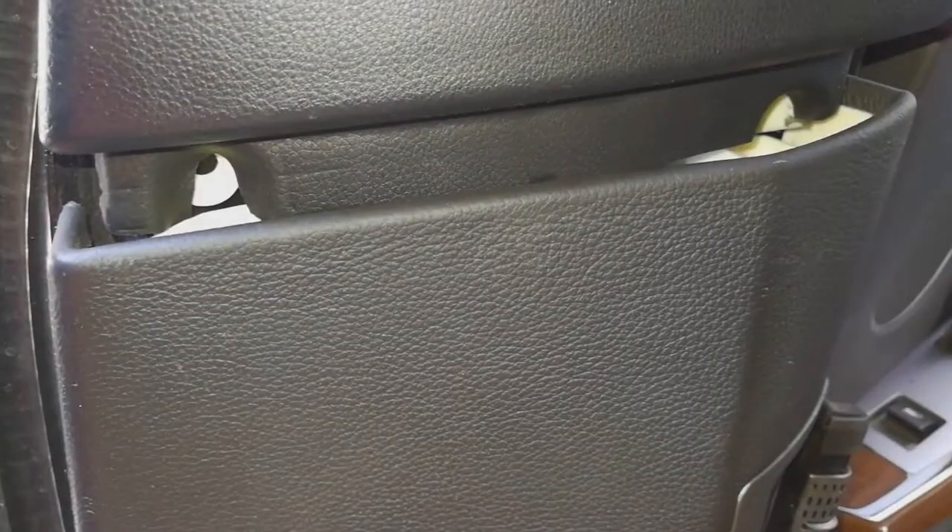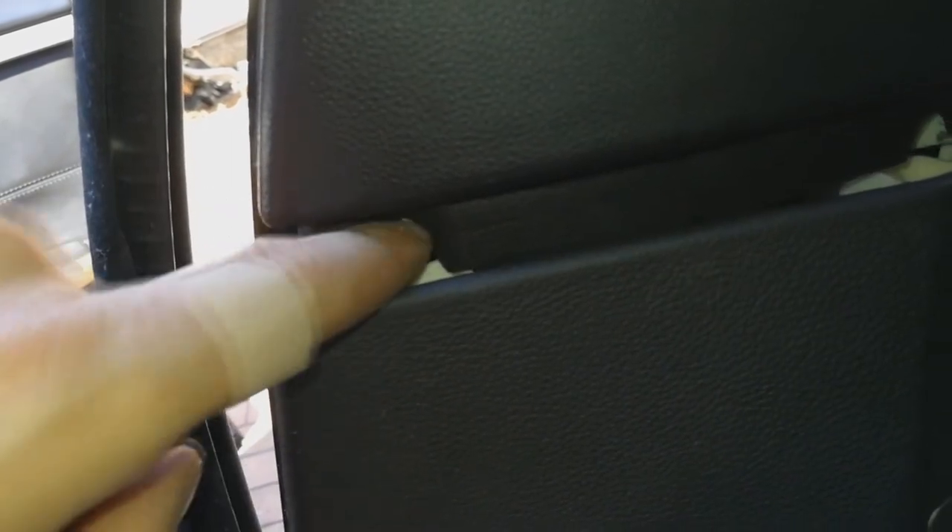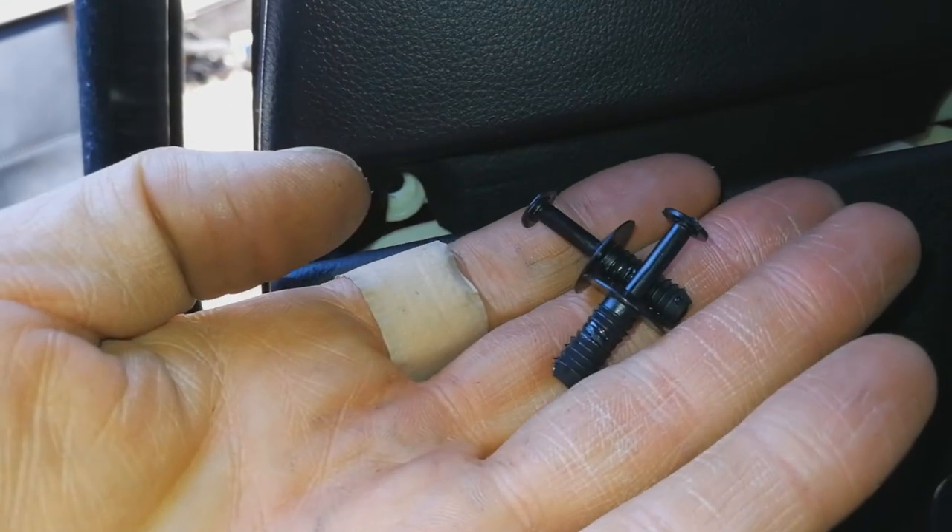Now we just put everything back together the way it came off. To get to this point you had to pull off the seals at the front, and on the back door there's a plastic clip — just pull it off with a screwdriver, there are no screws on it at all. Then you'll find push pins — one and two — and this one over here you just pull off; there are two clips, so be careful you don't drop that clip down below. In reassembling, just push the push pins back in, push the panel back, put the cover on, then reseal the seals. That's it — that's how I got to this point and I've shown you how to reassemble it. Thanks for watching.